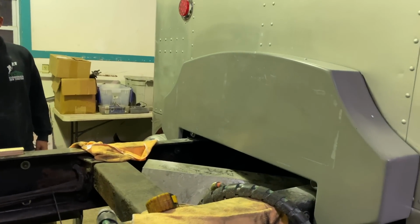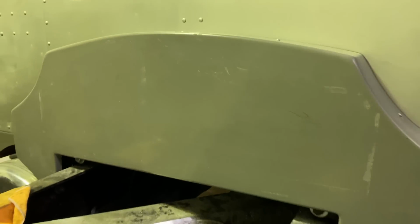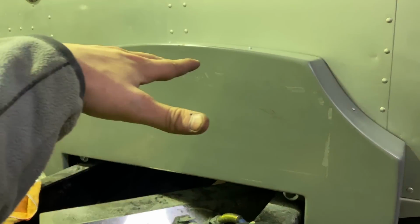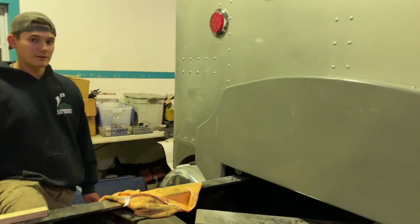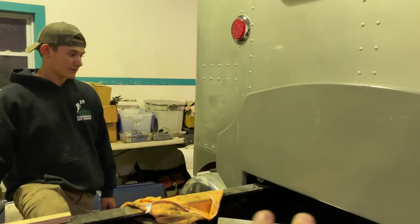This is with the truck aired up, so there is a little slot down there. When this first went up, we said this is where we should have mounted it, so it should have been down lower. But when we thought about it, right now the whole cab is aired up, so if this was lower, it would just smash against the frame rail, and it would rip everything out if the truck were to air down now. But how we have it sitting is perfect.